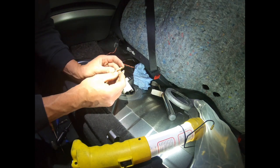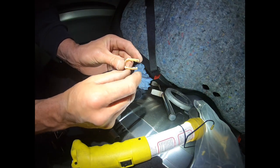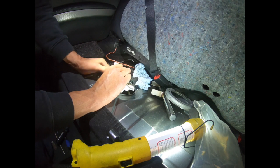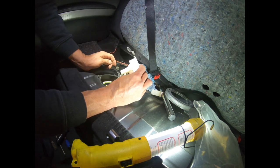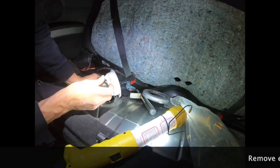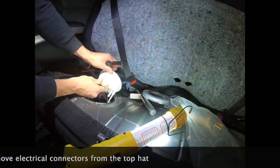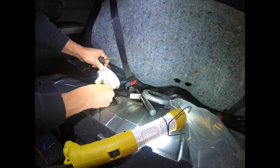It has these barbs on both outside and inside — that's that. Put that over on the gas-smelling bag. Remove the vent hose. The top hat starts to slide up. Release these clips and push. And that comes out.